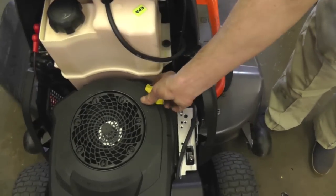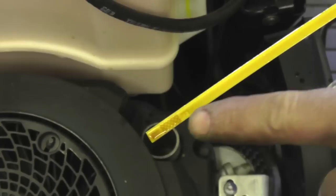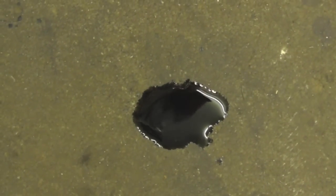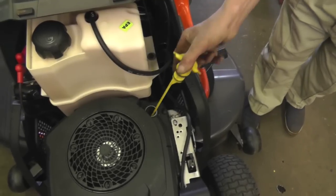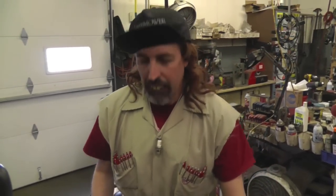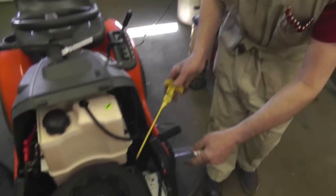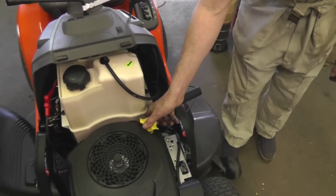Check the dipstick — if you can see through the oil it's pretty clean. If it's dirty black, that's bad. Another thing: if you run the motor and see exhaust fumes coming out of the dipstick tube, that's a sign of a blown head gasket. Another way to tell is the oil will be real black and dirty even shortly after you just changed it — maybe not even 50 hours on it — because carbon fumes from the blown head gasket are mixing with the oil in the crankcase.